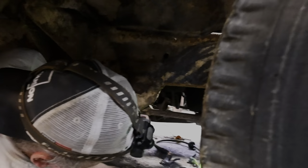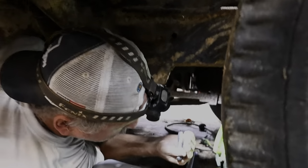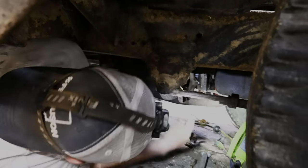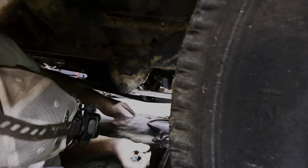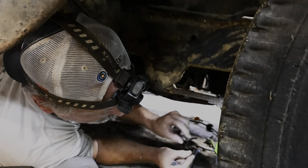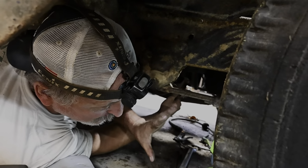Man, I don't know. You just got so much pressure on it that you got to draw the outside shell up with your bolts. You know what I mean? No, I don't. I've never messed with the clutch at all. Usually when you're putting it together, you got your bolts around here on the pressure plate shell. You get them bolts started, the plate part will go up against the clutch disc before that gets up, and you got to pull it in with the bolts. Oh, okay. And that creates your pressure against your clutch disc.